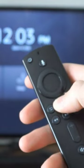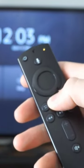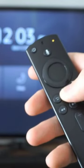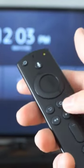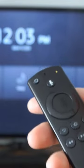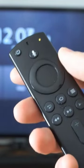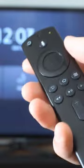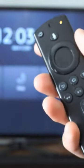That's an indication that your remote is trying to pair with a Bluetooth device. It's going to blink even faster if you hold down the home button for longer, but hold it down for at least 20 seconds. You may need to hold it for 60 seconds or even longer, and you might have to repeat this process until it eventually connects to your Amazon Fire Stick.